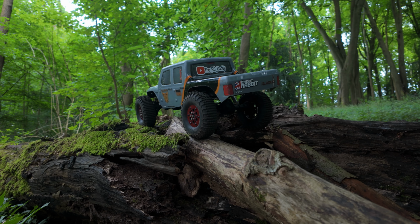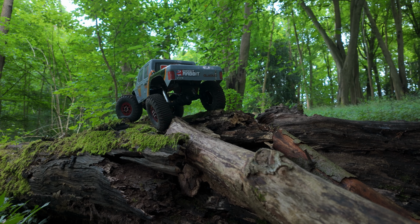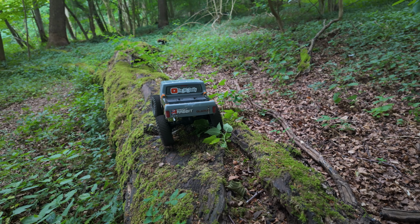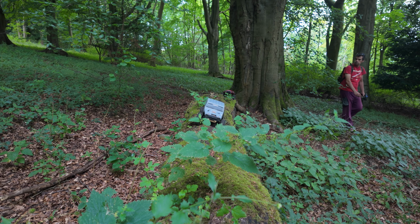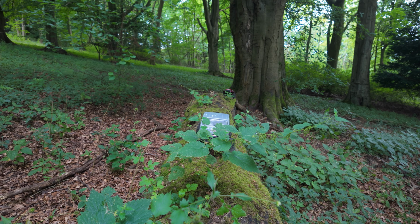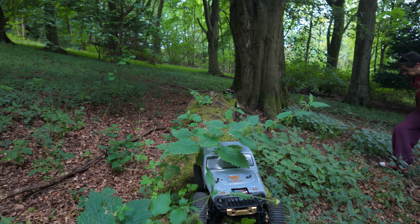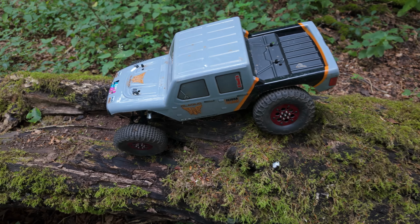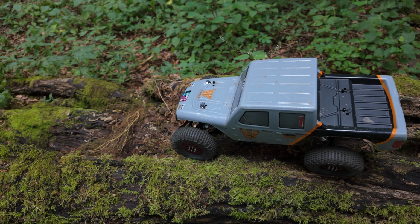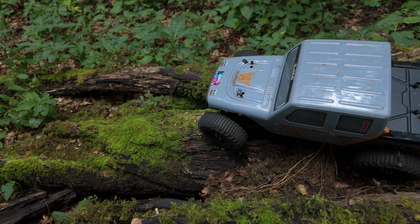These wheels that I fitted to Gladys are running a similar tyre and insert weight to the original tyre. So let's just talk about wheel weights, because that's where the difference really is. The carbon wheel weighs just 42 grams per corner, and the wheels that I was running weren't particularly heavy, but they were 89 grams per corner. So over half. So you can say that we've dropped across the vehicle somewhere in the region of about 160 grams. Just checking my maths. Yeah, it's a little over 160 grams of sprung weight, unsprung weight, which is the good kind, right?